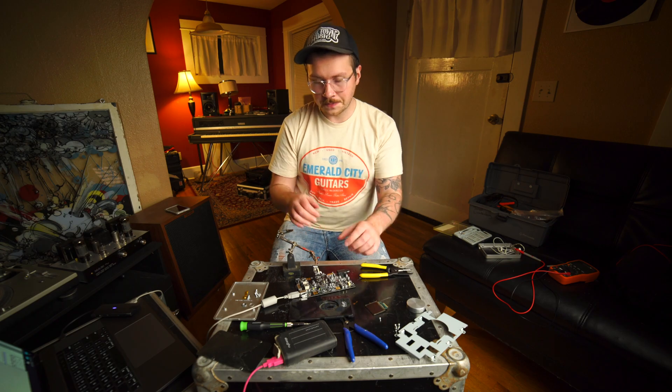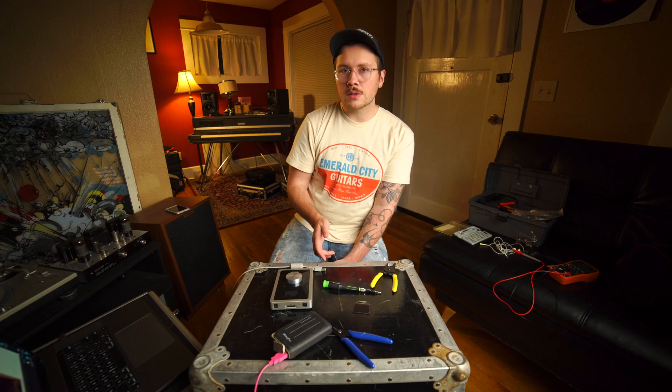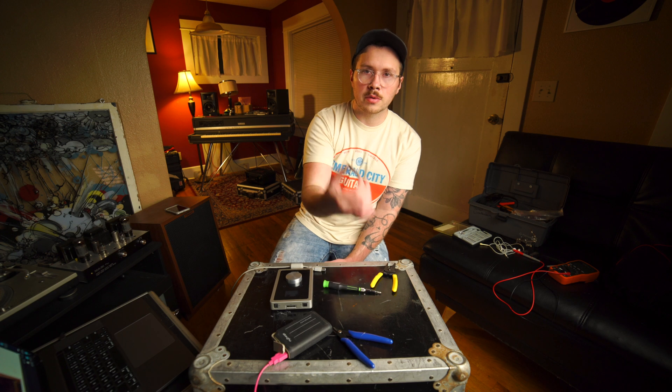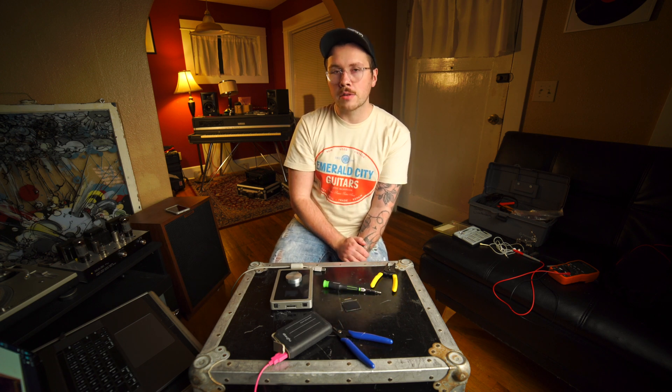So I think for now I'm just going to go ahead and button this thing back up without the OLED screen installed. One benefit I could see about not having the OLED screen installed: from what I've read, to use phantom power on this thing you need not only bus power but also 5 volts running to this jack right here. If we're eliminating the OLED screen and reducing some of the power consumption the Duet takes normally, maybe this is an advantage. So I'm just going to put it back together. To use the Duet you do not need this screen — you can control pretty much any of the functions in the software. I'll also link to a website showing how to take this apart and to the part number for this screen in the description.